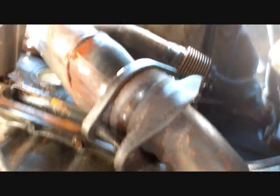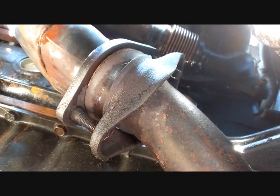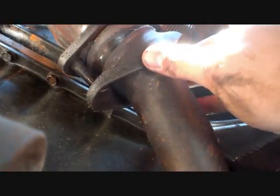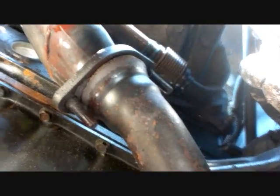Here on the underside, this is where the exhaust connects to the engine — make sure to take this off as well. I believe it was two 14mm bolts. The whole thing just slides apart and it's disconnected and ready for engine removal.